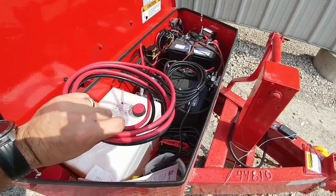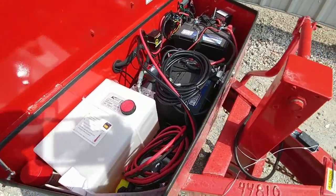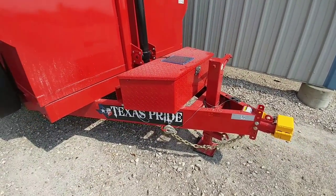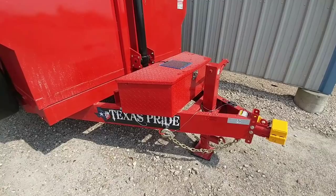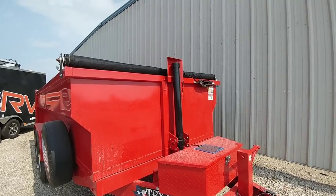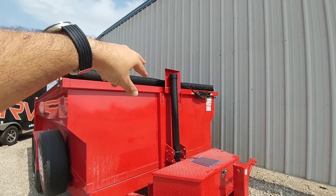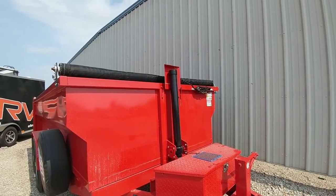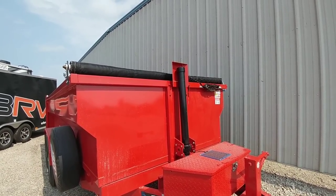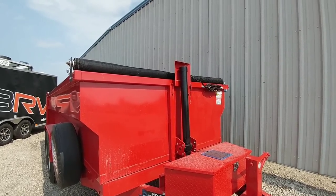The cable is all wound up right here - very compact. Set it right there. I'm going to close the toolbox lid. It doesn't take up any more room - it actually takes up about less than half the space of the two-gauge cable, so I'm very impressed with that. I had a couple of people saying why don't I have somebody spot weld the nuts on the back of the bolts and also spot weld the nuts that hold the winch into the mount, which I did. Right now they are welded in place. If I ever need to take the winch off it would definitely be a bit of a pain, but it helps make sure the winch doesn't end up disappearing.